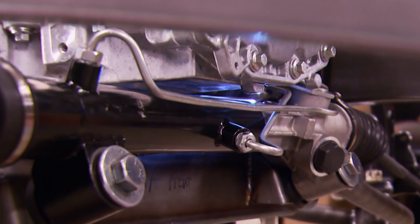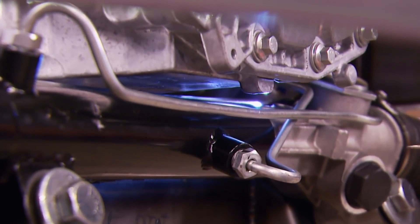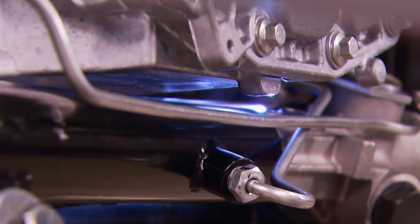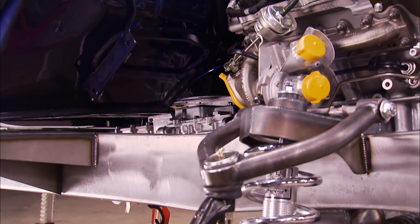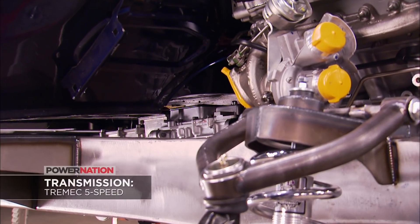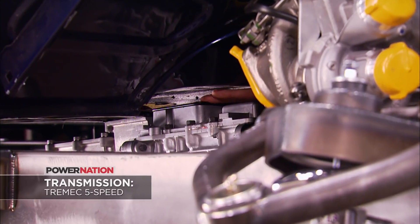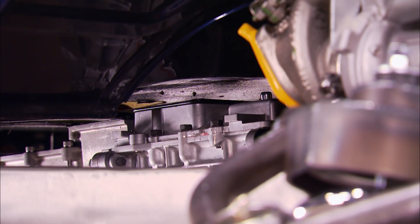The steering rack location was dictated by where the mounts are welded to the frame. Luckily, our V6 engine has a rear sump oil pan, allowing it to clear the cross member and the steering rack. We've got the engine lowered down as much as possible to still give us a little wiggle room and to reduce the overall rearward angle that the engine sits at in the engine bay. For the transmission tunnel, things are kind of tight — we've got plenty of room around the bell housing, but the transmission itself is close to the floor. We've got about three quarters of an inch of clearance at the tightest spot, so I think we're in good shape. If we had gone with the six-speed, I'm sure we'd be doing transmission tunnel surgery, but glad we went with the five-speed.